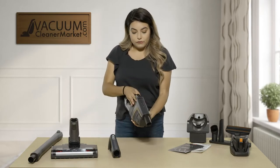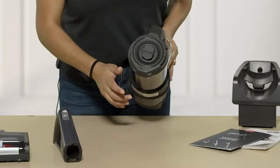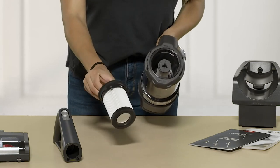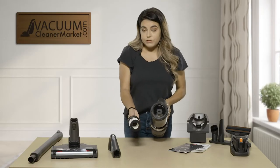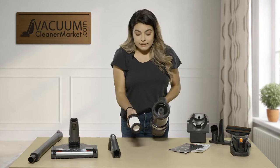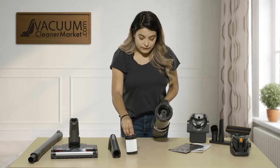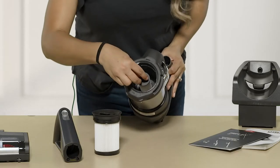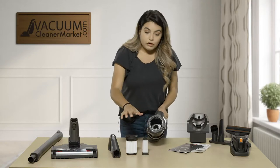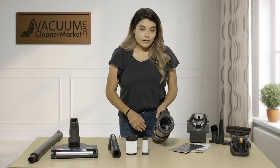For your dustbin, you have two filters installed inside. There's a little pull tag — if you pull it, that takes your first filter out. This one is washable. I recommend washing it about once a week just to keep your vacuum in good maintenance, and when you do wash it make sure you keep it out in the sun or dry for 24 hours. Then you have your second filter — pull that to the side and pull out. Both of these filters are also replaceable; I recommend replacing them every year or two to keep the suction really good.